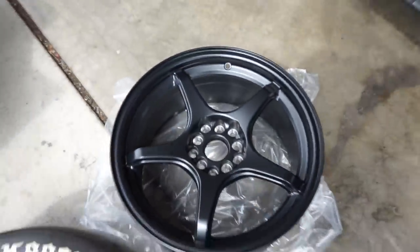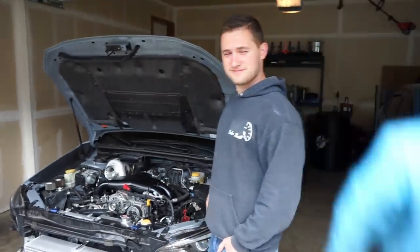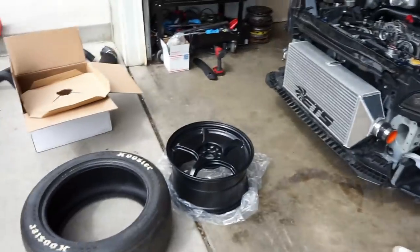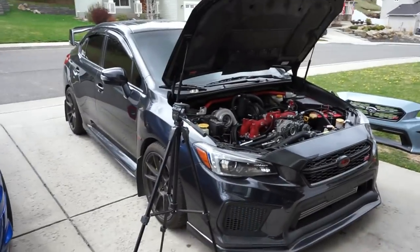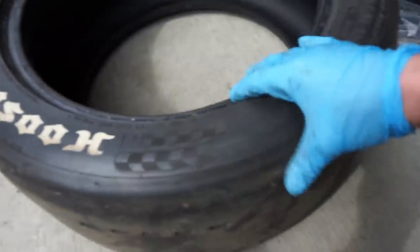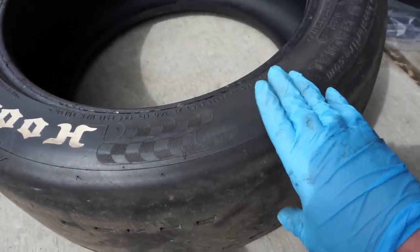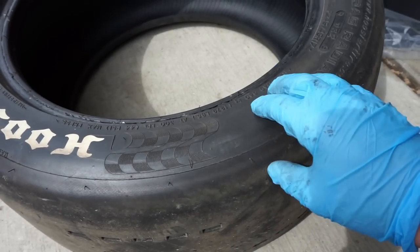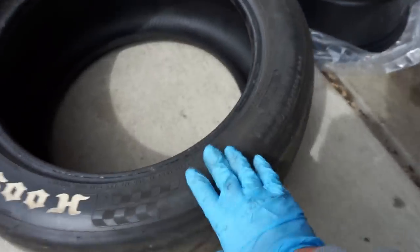I like the style. FastWRX.com is where I picked them up. I'll go ahead and put it down in the description for you guys. That way you can see if you want to get one of these for your 18 plus STI and you're trying to do drag radials or slicks. It's just nice to go to a 17 inch because you have a lot more tire options and you get a lot more sidewall, and that's what you want when you go to a slick or a drag radial. Drag radial, not so much. I know that term kind of is different, but for a slick, you want it to wrinkle. These will do that.